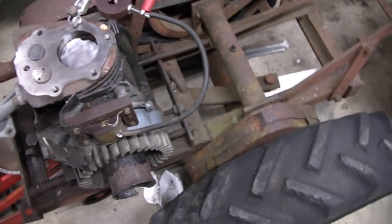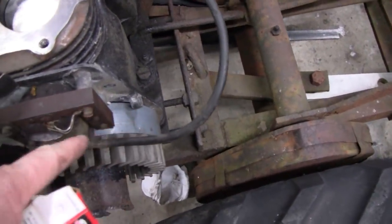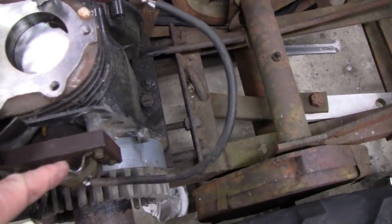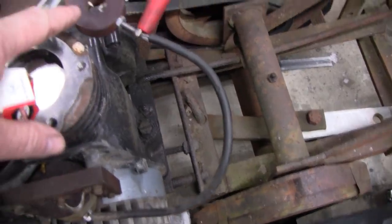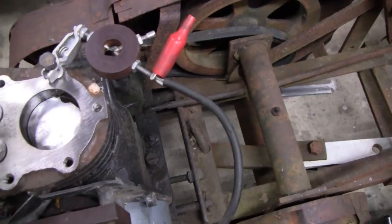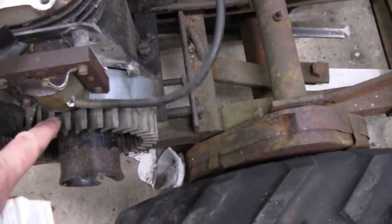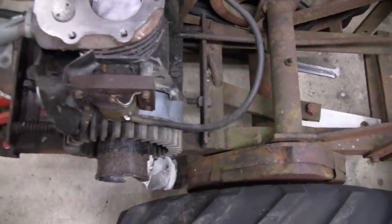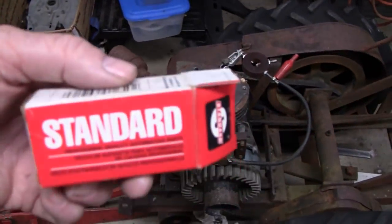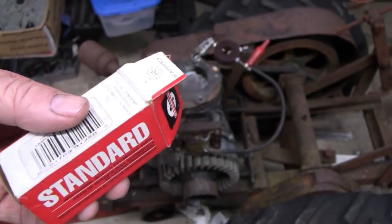Alright, here's what I did so far. I changed the wire, but before I changed the wire, the other wire, when I pulled it, I got one crack out of it, and it went the distance of that, which is about a quarter inch. But after that, nothing. So I'm thinking, we're pretty sure the coil's good, and the flywheel's good, and points are good. We put a brand new capacitor in there. But when I say brand new, I mean it was out of the box, never used.